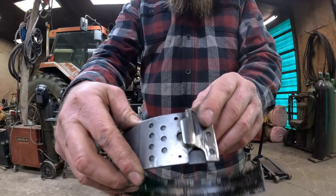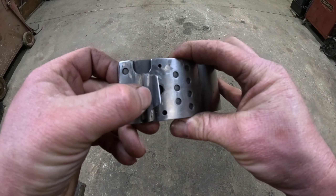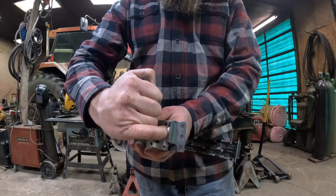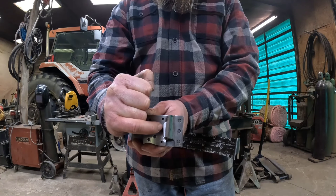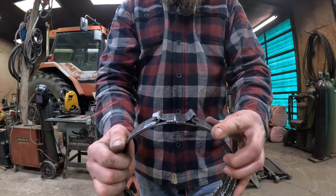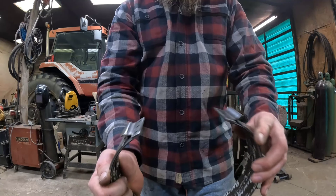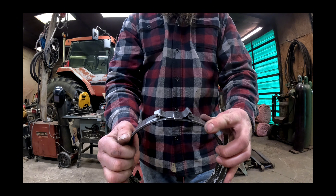This is the side we cut off - we had it pretty well cut off, so we can slip this side up around the drum. The factory ear stands about a half inch tall or taller, and the side I cut down and welded back up measures seven-sixteenths of an inch tall total, and that fit in nicely. Now on a 48RE it's a little bit tighter, so you might have to grind just a little bit more off.